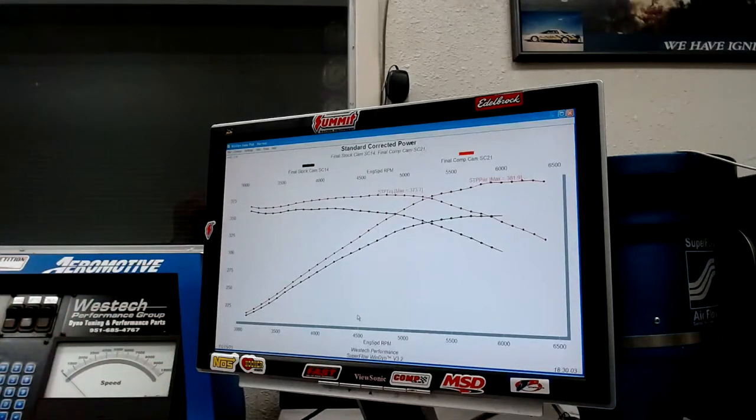On an NA motor, there wouldn't be as many changes. But you'd have to run through a series of them and make sure that the water temperature was the same, that the air temperature was the same, that the timing was the same, and then go through and change dynamic compression with different camshafts. You'd also have to be able to monitor and have very accurate and repeatable knock detection to find out what that sensitivity is and how much you've adjusted it. A lot of guys are doing this with boosted motors, not as often, I think, with NA motors, although the effect is still the same. If you put wilder cam timing in an NA motor, you should theoretically be able to run more timing and have less of a chance of detonation.